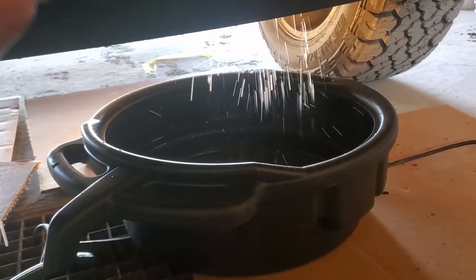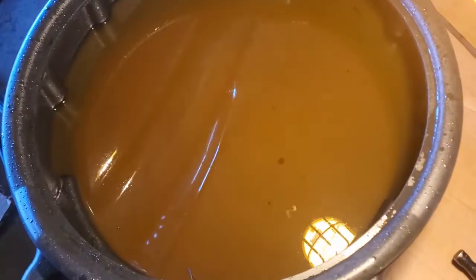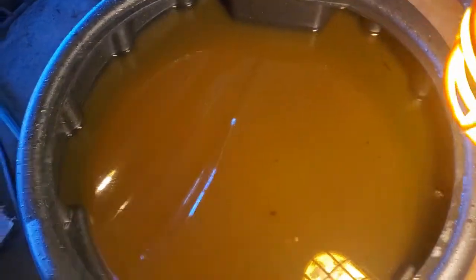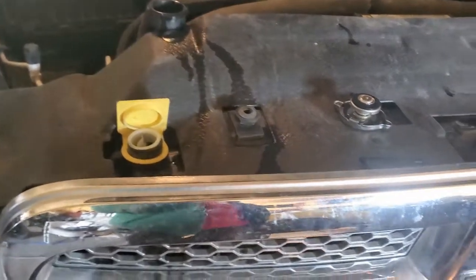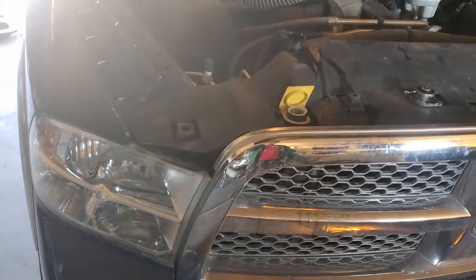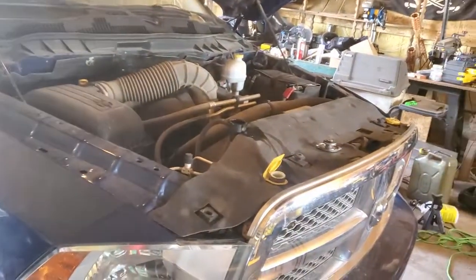This thing takes about five gallons. I'm just going to go until it's full and keep track. We'll let this finish draining. So we tightened it back up — that's the stuff that came out. It had the greeny-yellow stuff in there before because this thing boiled all the coolant out once upon a time. So it's not supposed to be that color, which is why we're doing the flush. I'm going to refill this up with all the distilled water, and I'm going to run one more flush through it. Make sure she's all topped up, get the air bubbles out. I've also got another video where I'm changing the brakes — while I'm doing the brake-in period, that'll help circulate and heat it up.